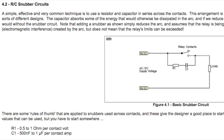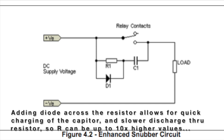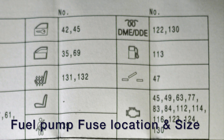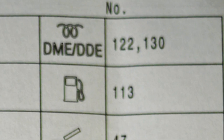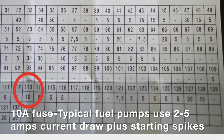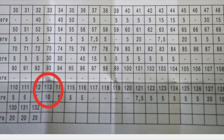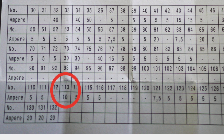If you use the modified circuit where you add a diode so the inrush current can bypass the resistor, you can then increase the resistor up to about 10 times the normal value — so that's the circuit I went with. We know the voltage is 12 volts. The amps for the fuel pump are a bit harder to determine; looking at the fuse diagram, it's fuse 113, which is a 10-amp fuse for that fuel pump circuit. Based on literature, about 2 to 5 amps of draw current is typical for a fuel pump motor, so a capacitor of about 10 microfarads should be okay.